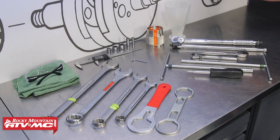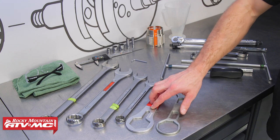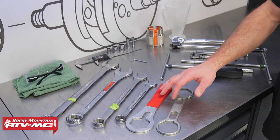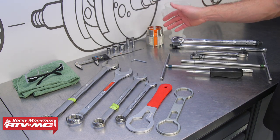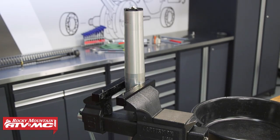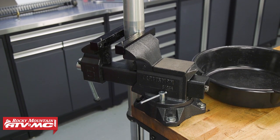To do this job we're going to use a Ratio Rite and some common hand tools including a torque wrench. We have some fork cap wrenches — one fits the stock WP AER forks and the other fits the Racetech conversion kit. We'll have a link in the description for both of those wrenches. We're also going to use digital calipers, fork seal drivers if you're doing the seals at the same time, the seal bullet, rags, safety glasses, a vise with soft jaws made specifically for suspension, and a drain pan.